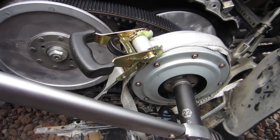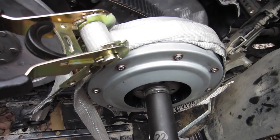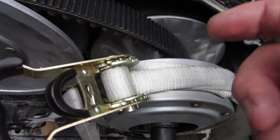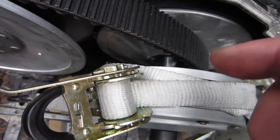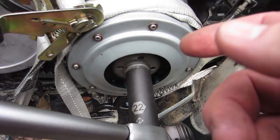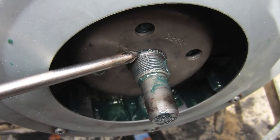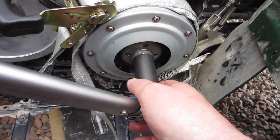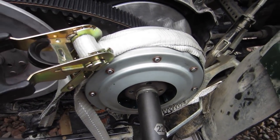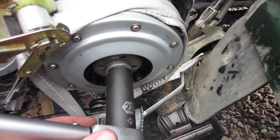Here we are day two — we're putting it back together. Already have most of it on there. Put the inner sheave on with my shim and the spacer and the outer sheave. Make sure you have splines sticking out through your cam plate before you tighten it up, or else something's not right — take it off and check it. Wrap the tie strap around there to your foot peg to keep it from turning, then get your torque wrench on there and torque to 100 foot-pounds — I think it's 72 foot-pounds for the 450.